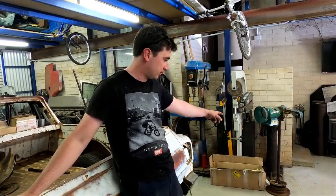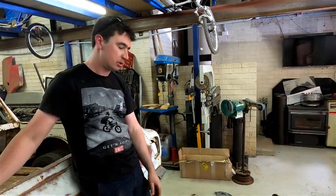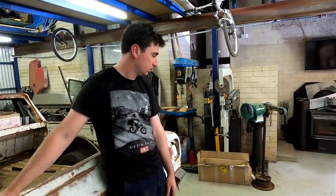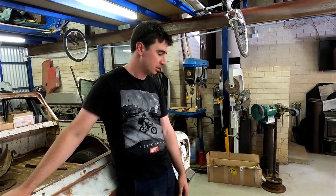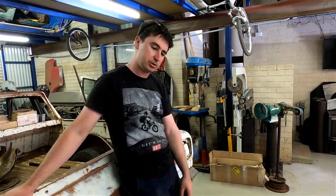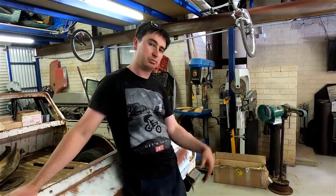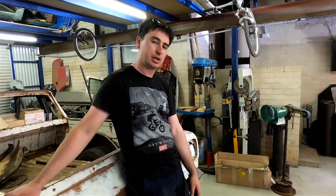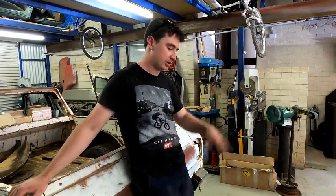We're also going to cut the axles down and shorten those temporarily, purely just so we can keep it rolling. We don't have it in the budget yet to get billet axles made, so we're just going to cut and shut the original axle, and we'll probably skid those and wait till they break until we build a diff. So yeah, we'll see if our welds hold up. We're going to get all this cleaned up now and get it in the saw.